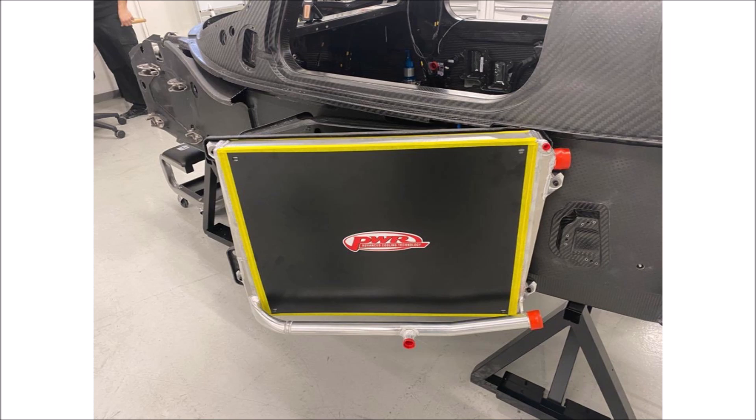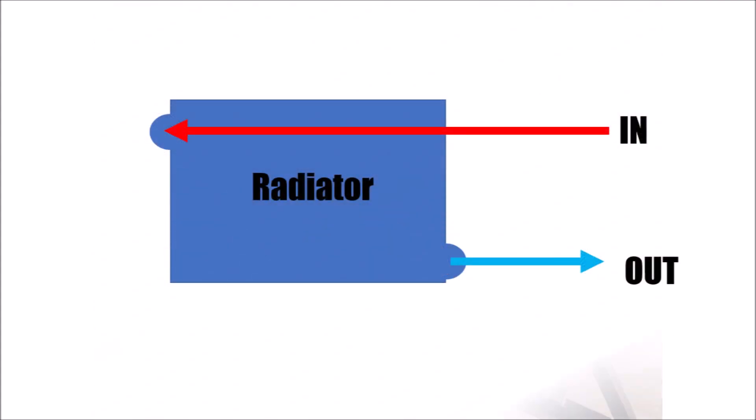If we take a closer look at the radiator we can see the higher-sitting intake on the inboard side and the outlet on the lower outboard corner. With this configuration the hot water goes into the radiator on the shortest way and the cool water exits with a pipe that is running behind the radiator. Hot air is exiting behind the radiator and you heat the pipe with cooler water with the heat you just rejected in the radiator. It's a small detail but for maximum efficiency you would usually choose the intake to be on the outboard side and the outlet inboard to avoid heating up while crossing over.